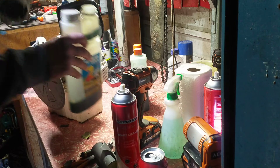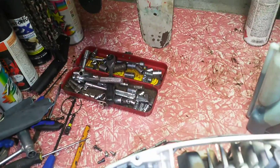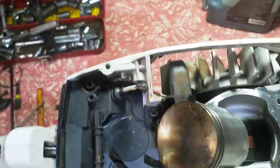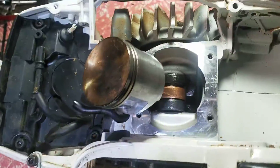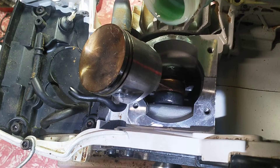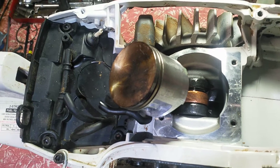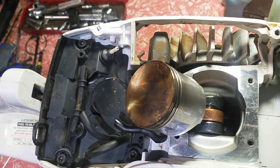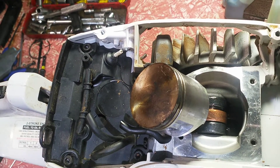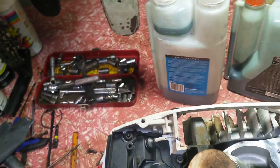First I got some two-stroke oil. So there's a big end bearing there — I always give that a quick glug on that bearing. The reason I do that is because when you first start these things up it's torture on the rod and saw. There's bits of metal; if you use new rings, everything's wearing in, so why not lube it up.